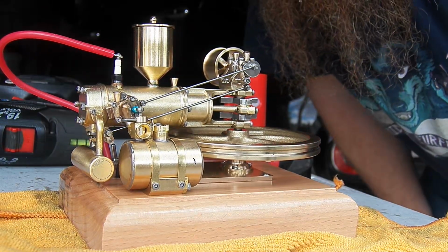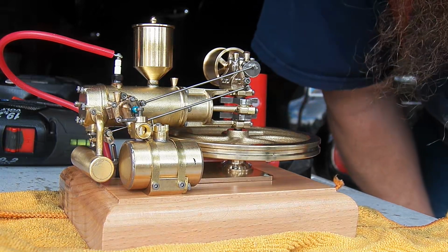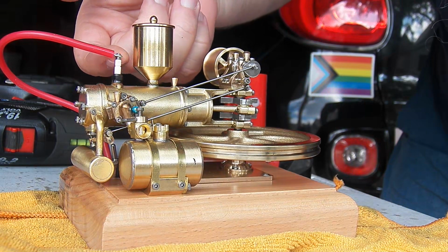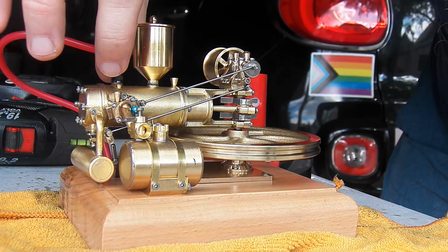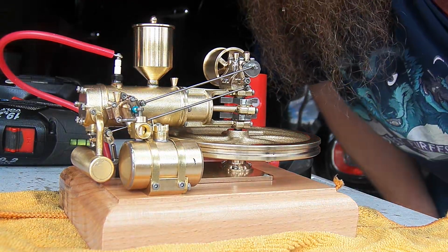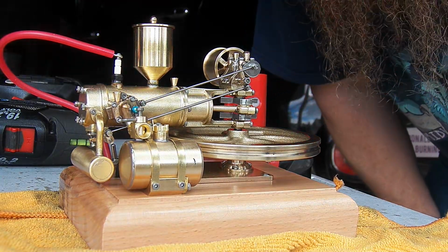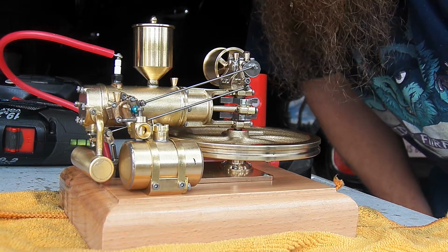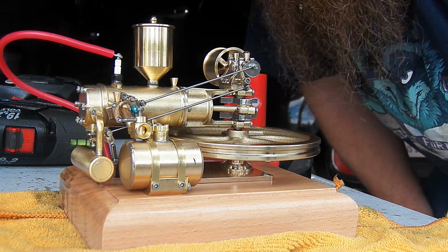So I'm gonna have to modify these plugs to beef up this insulator. I'm probably gonna end up just making a silly big donut around it to make it a longer arc path, because that's how you keep it from arcing on the outside instead of sparking on the inside.